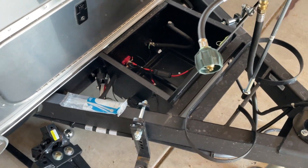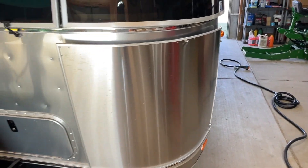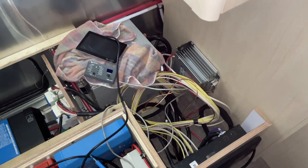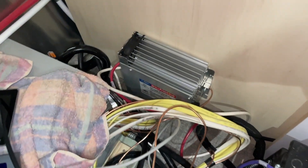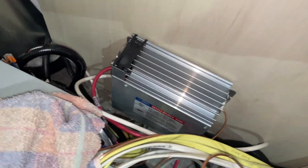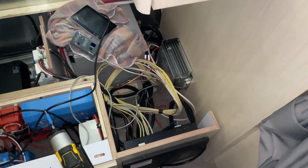I've done all of this with the power off — everything's been turned off: AC is off, the battery is off, everything's been turned off, so from a safety standpoint we're good. Now we're going to remove the old converter and recapture the common and the 12-volt line — the old 12-volt line — and move them over to the new system.